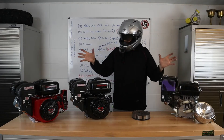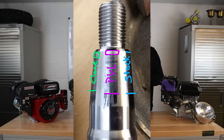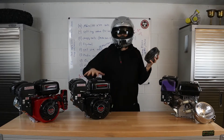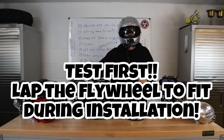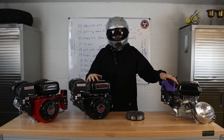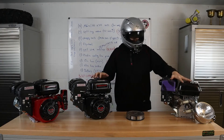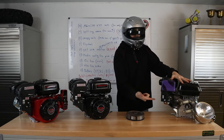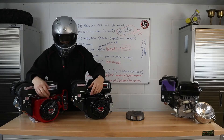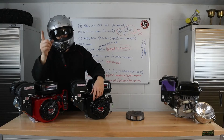Let's take a look at our charging flywheel options. I've checked a number of them and learned that a lot of clone flywheels — such as the one I'm holding here — will fit in a Predator non-hemi engine. If you have a Predator hemi engine, there is a Kohler part number I'll try to put in the description below, but I have not tested that. These are generic Predator engines, each costing about a hundred dollars. Before you start any of this, make sure your engine actually runs first.